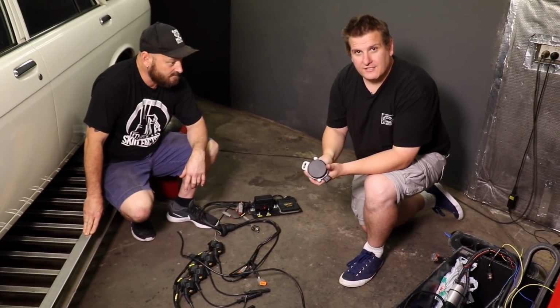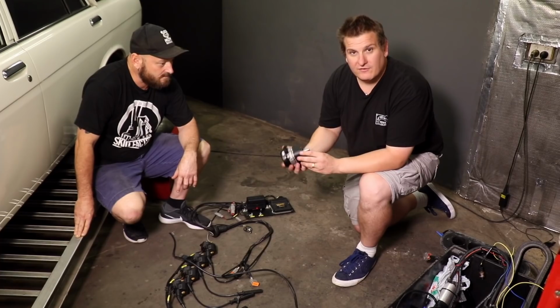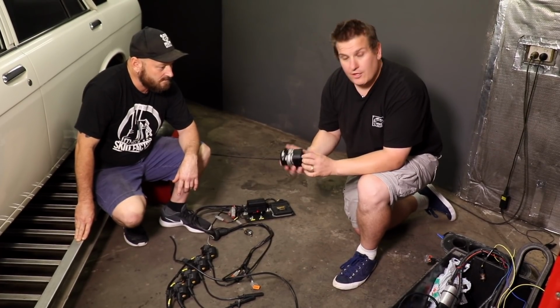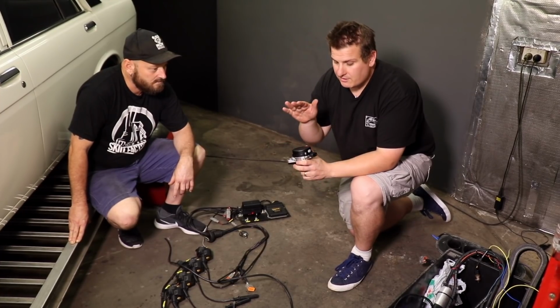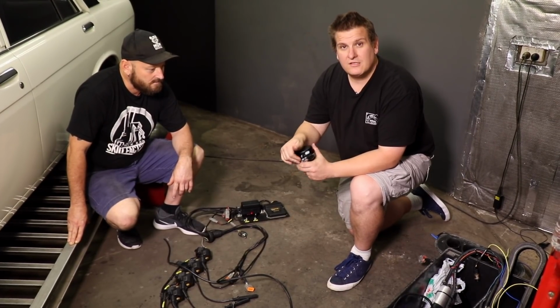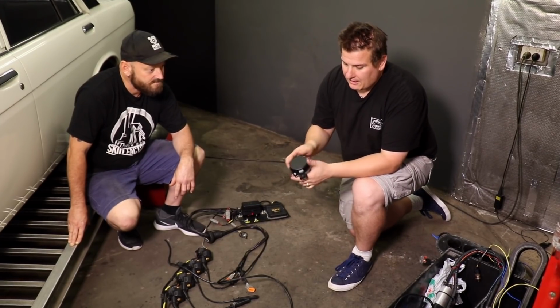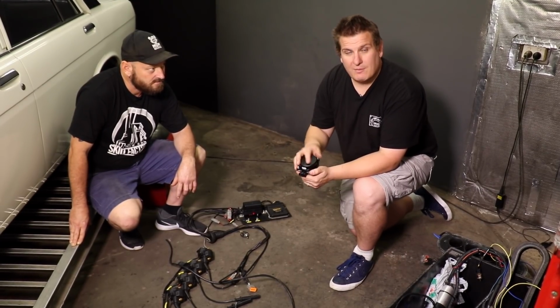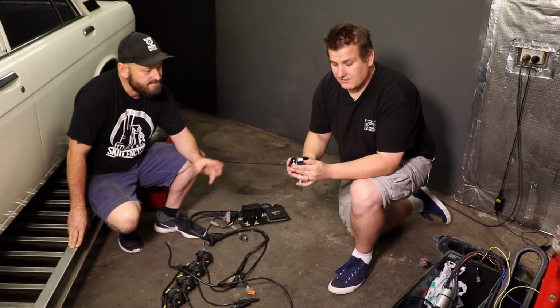This is the crank angle sensor distributor replacement we're putting on the car. It's something that I've developed to help people do EFI conversions on these old engines. It's compatible with 4 and 6 cylinder motors and sequentially capable on 4 and 6 cylinders. It has a 2-tooth pattern inside it with 2 reluctors, so that's what makes it sequentially capable.